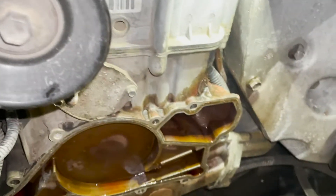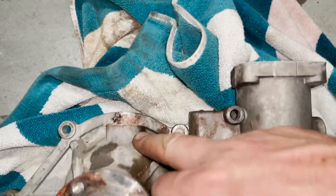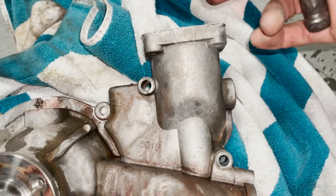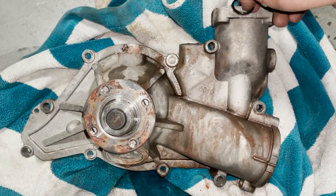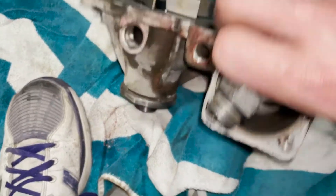Just got a piece of cardboard, cut a hole for the screw, and put it in there. Now we've got a nice area to work and the radiator's protected. Water pump is off — lost a bunch of coolant when I did that because it came out of the engine block, but there it is, that's the old one. Took the fittings out for the heater line, the temperature sensor, and the coolant filter, and I'm transferring those fittings to the new one. Looking at this one, I think it's a Gates as well. I'm not exactly sure why it was leaking because this is all nice and secure — there aren't any leaks coming out of there. It was leaking somewhere up in here.